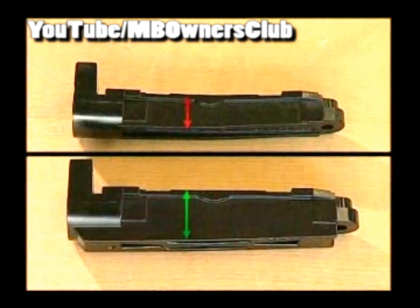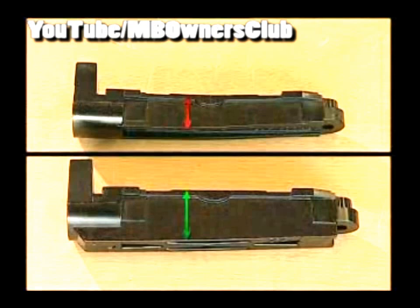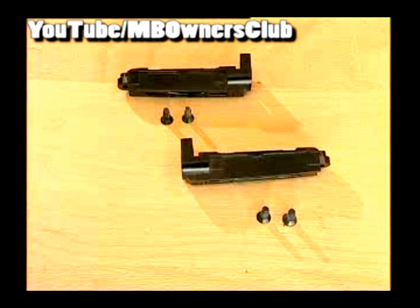The new bearing plate has been modified to provide greater stability. You can see in the lower part of your screen that the sides have been made thicker, so they're not as easily bent. The bearing plate must always be replaced on both sides, because you can presume that the other side, if not already bent, may bend soon. For this reason, the repair kit always contains two bearing plates and four screws.